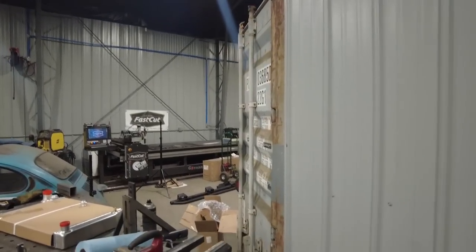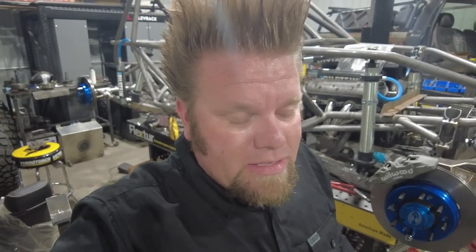And that way I'm not relying on a bolt and a mount for a piece of aluminum into that tube. And it'll allow for a little bit of expansion and contraction on the radiator if we have to, and then remove it. It'll just be two clamps to basically pop it off and put it back on. I think it'll be pretty cool. This is the same size radiator that he runs in most of his rigs. I mean, it's a fairly decent size, a big, thick 3-inch core, so hopefully cooling won't be a problem. If it is, I can always step up to a larger radiator later.